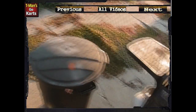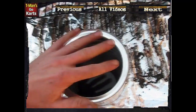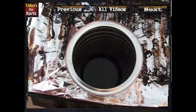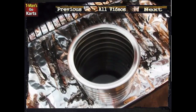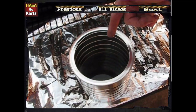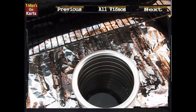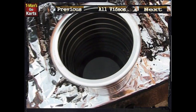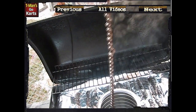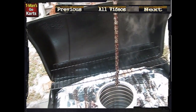I finally got those off. Now we're going to come up here and check out what this is doing. Is it boiling? Not quite, but I can tell that stuff's really hot because there's steam coming off of it. Now all I need to do is get a wire and fish it out, let them drip for a while, and then put in the other ones. The guys on DIY Go-Carts told me to use old oil — I can't remember exactly why they said you want old oil instead of new oil, so maybe you guys can jump over there and ask them. Get her hot enough to the point where there's steam coming off of it. That's what I call a good chain.